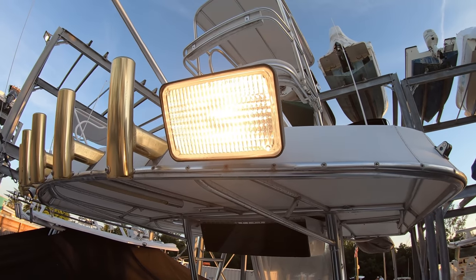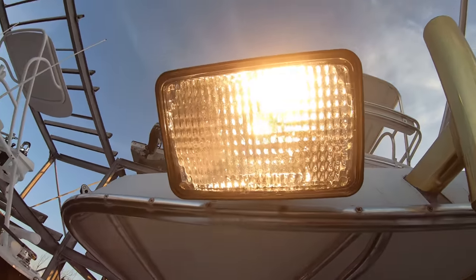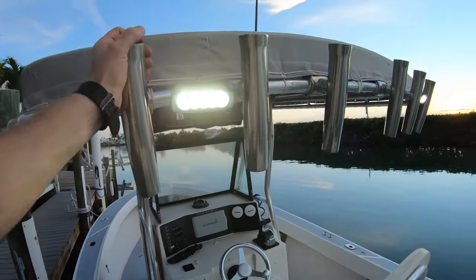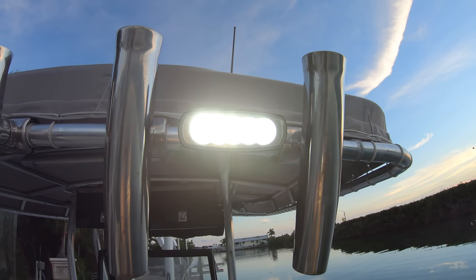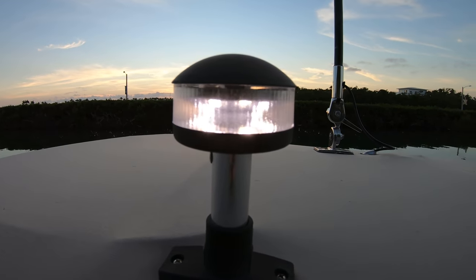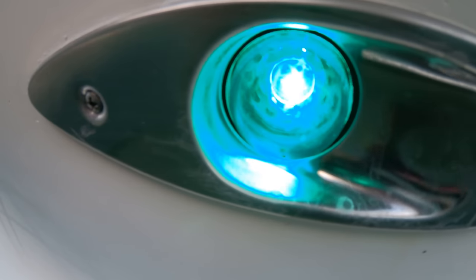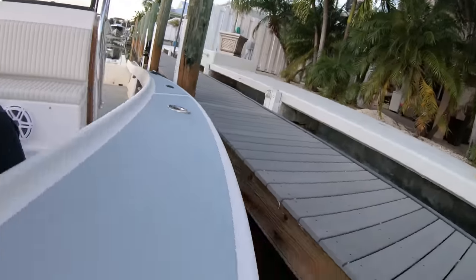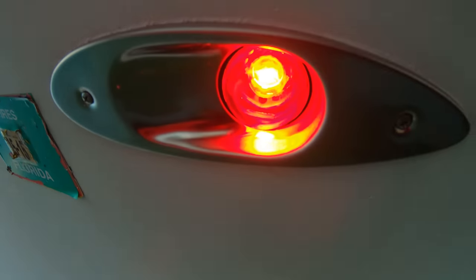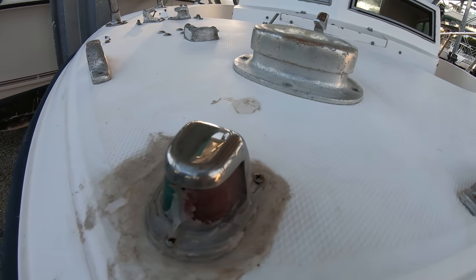I also think that spreader lights with regular bulbs last longer than LED spreaders. Even though we just put LED spreaders on our boat, from what I've seen it doesn't take long for the LEDs in the spreader to slowly go out one by one, just like the underwater lights did. But we wanted this smaller, black light on our t-top if nothing else just for the clean look, so we'll see how long they last. We also put an LED anchor light on the boat, but stuck with regular light bulb lights for the nav lights. Honestly, I would say it's probably best to stay with regular incandescent lights for the anchor and nav lights, simply because when you're on the water and they don't work, at least with bulbs you can pop them open and most of the time get them back on. Whereas with LEDs you're out of luck and won't have the light until you find the time to replace it — and that can turn into its own chore.